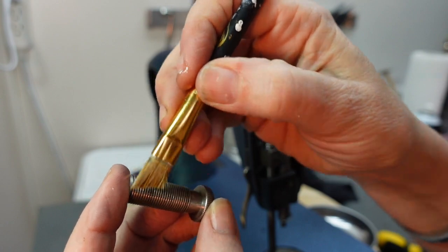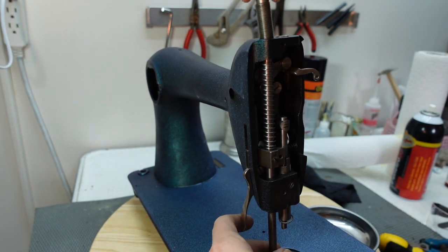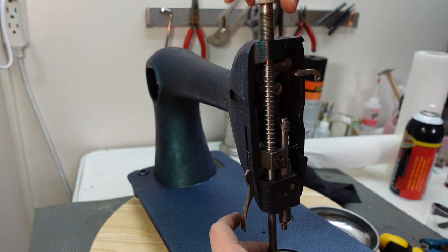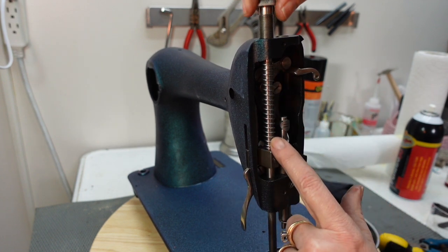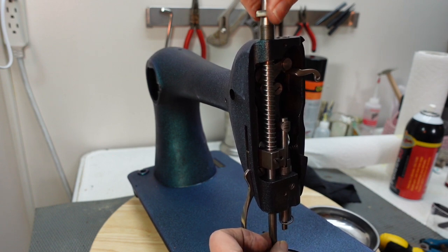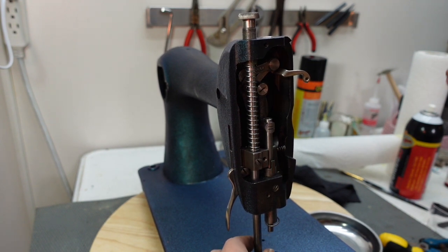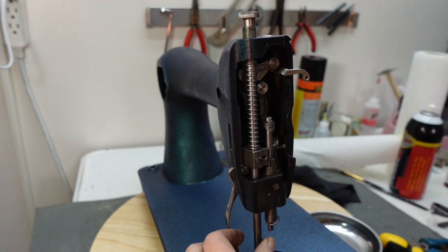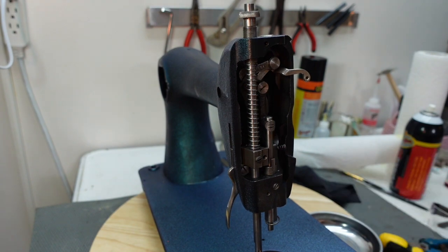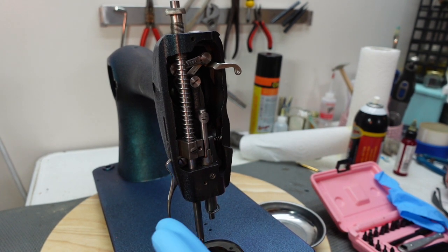I'm just putting a drop of oil on the threads. I just polished the top of this because the threads won't be seen — to keep it moving in and out easily and hopefully never deal with rust. I had already gone ahead and polished the spring and this presser foot rod, so it is good to go. I'm going to adjust the height of the presser foot after I get the plates and everything in. For now, I'm just going to tighten this enough that the rod's not going to fall out. Now that I'm getting into oily things, I'm going to put my gloves on because I tend to make quite a mess.